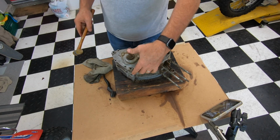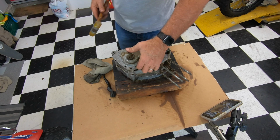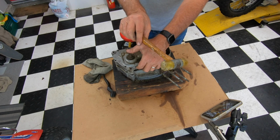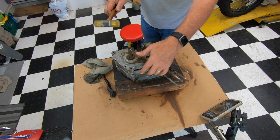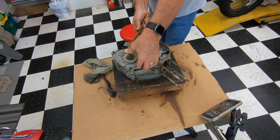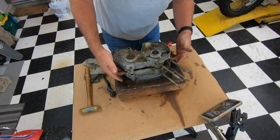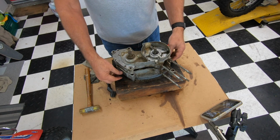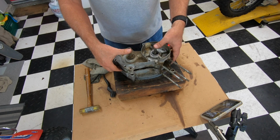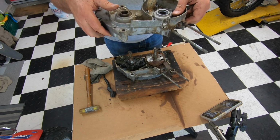If you put pressure here, I put my fingers here, put pressure on here, and I'm hitting it right here. Again, don't use a metal hammer, use something plastic. So I'm pulling up on it here, and on the tabs, like for the engine mount, pulling up. Okay, so now it's broke loose. The only thing that would be holding this together is a liquid gasket. So now that it's fully broke loose, I'm gonna put my fingers right here, and pull this side case off. Just like that.